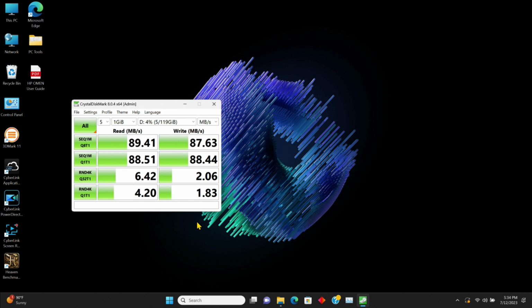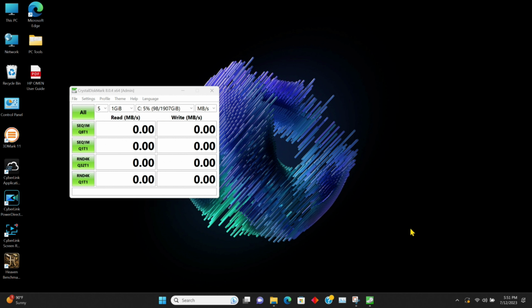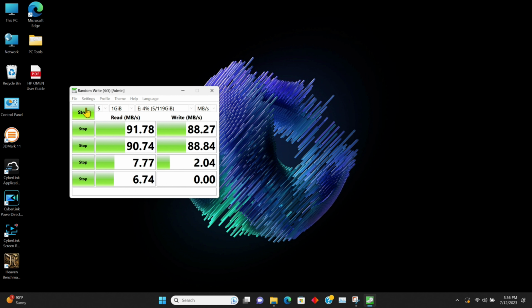The exact same SD card, but going through a USB 3.0 adapter. The same speed SD card, connected through a simple SD card to USB 3 adapter that I have. That should be drive E. So I'll put that on there and we'll test it and see what speed we get. Okay, slightly better on the read, but basically the same write speed, so that's negligible. Now let me try the same adapter on the expansion USB from Intpw.